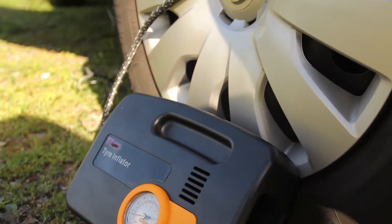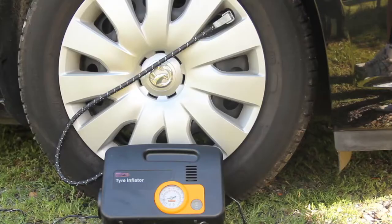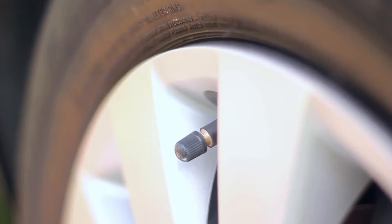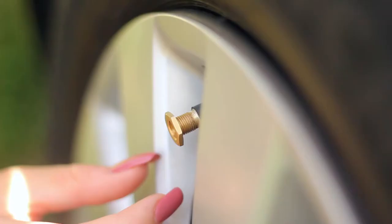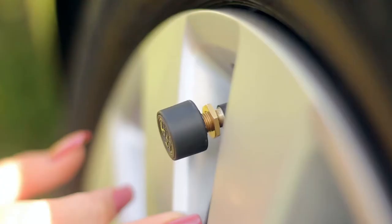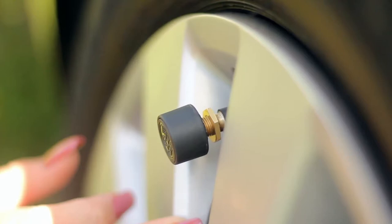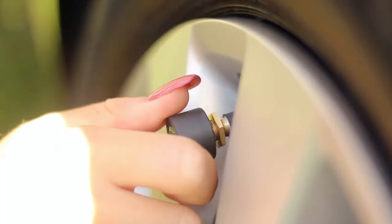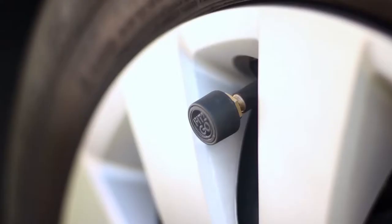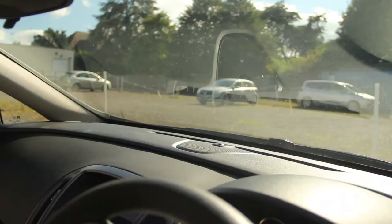The most important part of the fitting process is to ensure that all tyres, whilst cold, are at the correct recommended tyre pressures. The Fit2Go sensors are also simple to fit. Remove the dust cap. Screw on the anti-theft lock nut. Screw on the Fit2Go TPMS sensor. And using the special spanner, screw the anti-theft lock nut against the TPMS sensor. There are two LEDs in the sensor which flash red five times to indicate fitting is okay.